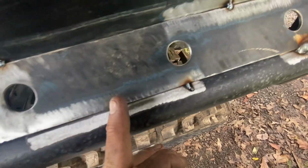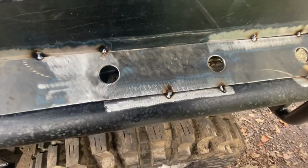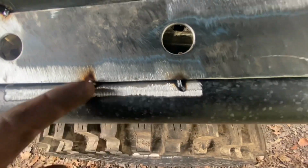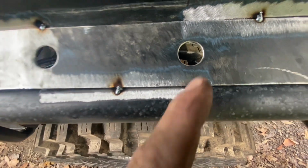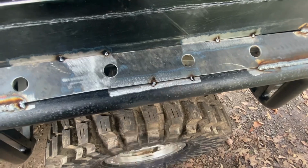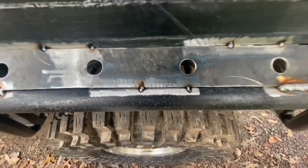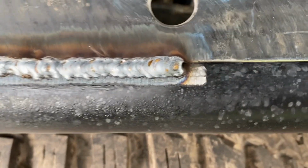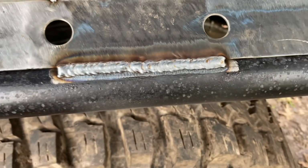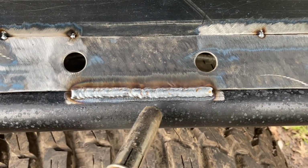So as I'm coming along here, I bump into that, and that is what tells me to finish the weld. It's a real small tack, so when you're running over it, you run just a little past it, and it just looks like the weld sweeping through. It doesn't make the end look bad or anything. So yeah, there's a little tip for you. That run over the tack just ties it in with the rest of the weld. But yeah, you can see I kind of lost where I was going and stepped down a little bit there.